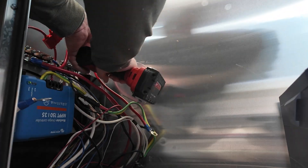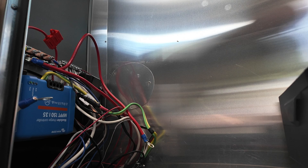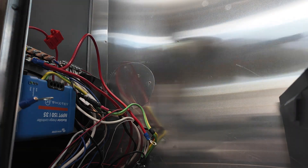With that secure, I'm going to plug the vent hole out of the wall. I cut another disc from that same sheet of aluminum and now I'm going to rivet that in place. If you've never done a rivet, don't be intimidated — it's really simple. You drill an appropriate size hole, stick the rivet through, slide the riveting tool onto the rivet, squeeze the handle, bam, it's done. If you own an Airstream, you should know how to do rivets, so this could be good practice.